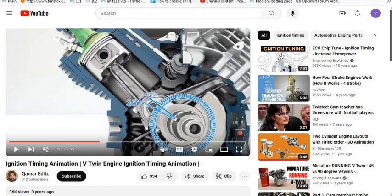Let's just say that I find it's over here at 90 degrees on this wheel. And so regardless of where this gap is, we're going to be interested in this over here, not this over here, okay? So that's really not telling us anything about the relation of the top dead center to the gap. Except it would firm up our suspicions that if we know it's down there and we have to go down on the piston 90 degrees on the crank to get closer to it, then we say, oh yeah, it was definitely over here and now it's over here. Okay, so we know that.